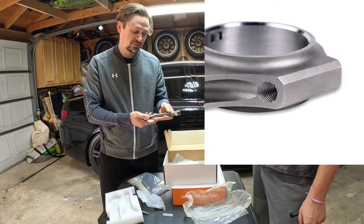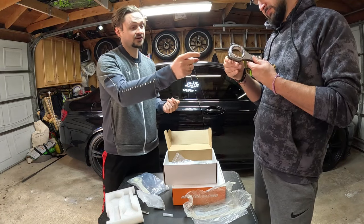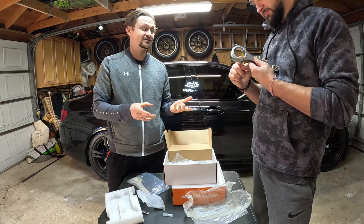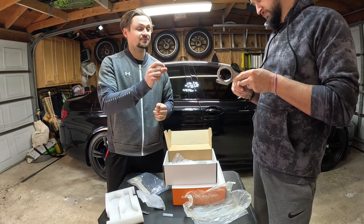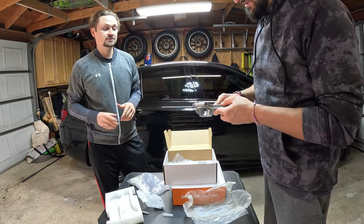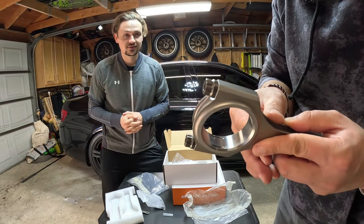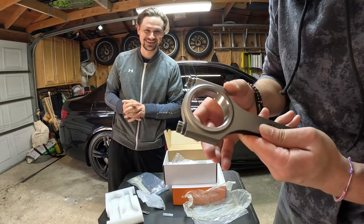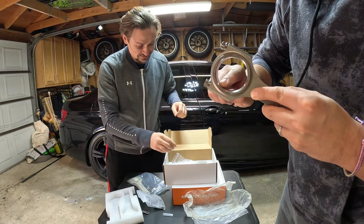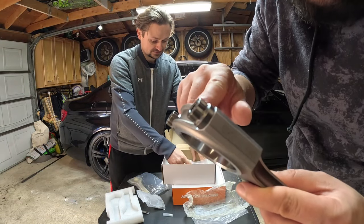What about bearings? You've got to buy the bearings yourself. That's where we'll need to blueprint the engine and figure out what kind of bearing thickness we need. Some people use standard bearings; if you're going to run more boost, you might want more room for oil. I've never seen it where one of the sides is kind of cut and slid in like that. That's called a tang — every motor has the tangs and they go in.